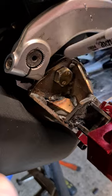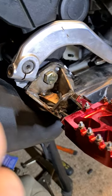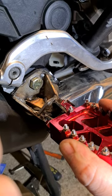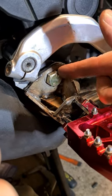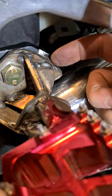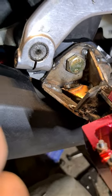This opening also lets me get in and clean it — I've deliberately left gaps to clean mud out since it's done a bit of off-roading, and to get the nut in and out and tools on to remove it quickly once the peg's off. This is 3mm steel, mainly a big washer on top of the 3mm plate and another 3mm step at the back for the indentation that holds it in place. I could drill another hole and tap it for a bolt, but it won't rotate once tightened up.